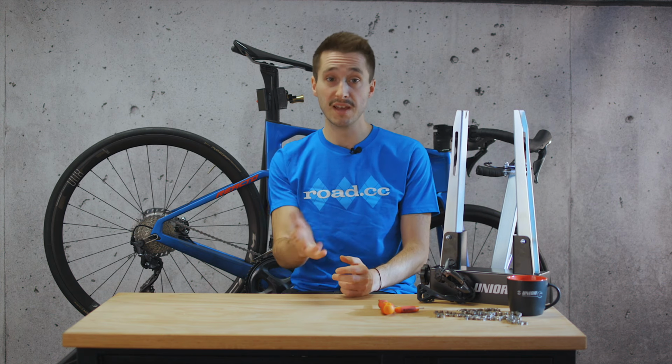If you do all of this and your chain is still coming off, there are several other things to look at. Firstly, your front derailleur could have moved and you'll need to check that it's positioned correctly. We don't have time for that in this video, but leave a comment if you'd find a separate video just for this beneficial, and in the meantime, take a look at our article on how to index front gears on the road.cc website.